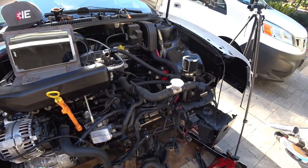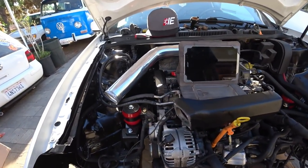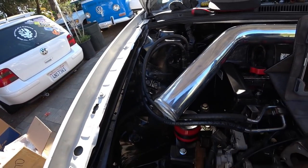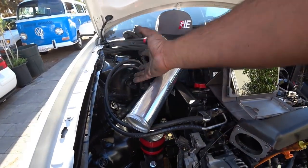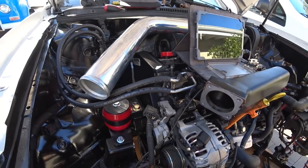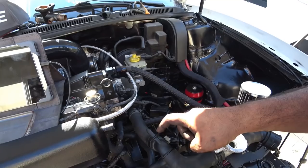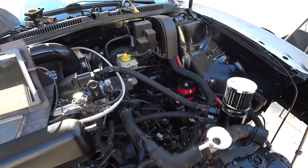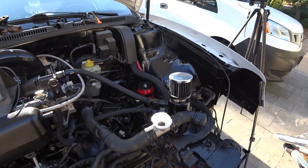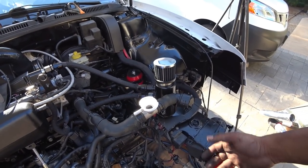It's the easiest thing you can do on these cars for aesthetics and making it look great. To recap: get a paper clip, cut it to size, bend it into a U-shape, put it in, done. Yank out the cooling ball and all the hoses — you don't need them. Go over, get your cap set up, plug it in, put your clamp on it. On the flange, cap off the T-setup. Cut your hose in half, flip them completely, attach them, and cut accordingly until it fits correctly. That's your cooling ball delete — that's how easy it is.